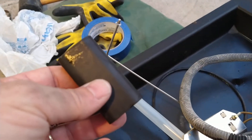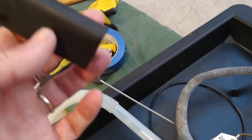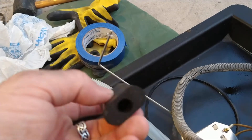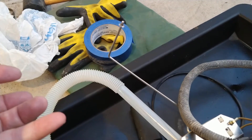The float's not in there anymore, so I have no gas gauge — it's always empty. Here's the float, it was in the tank. Now I could see if it came off the end, but look — it actually deteriorated from moving, hollowed it out, and the float fell off.